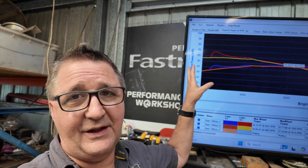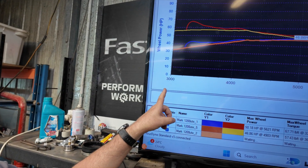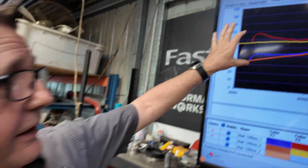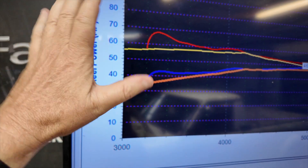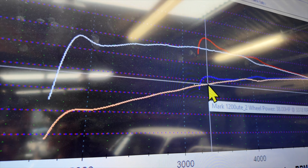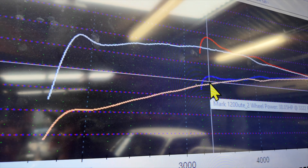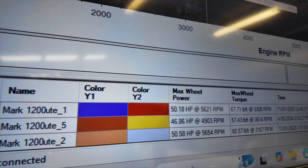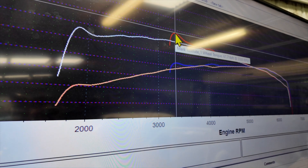Shannon's changed the actual rate — we're starting at 3,000 at the moment, but he's changed it to switch on at about 1,600, so it'll even out and smooth it so we can actually see what it's doing. I think it's getting a bit hot — that air temp's up to almost 60 degrees. It's disgusting. It hasn't really affected the power, it's affected the torque.